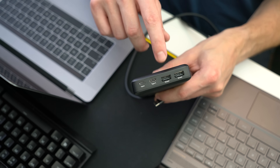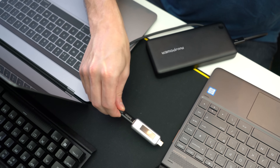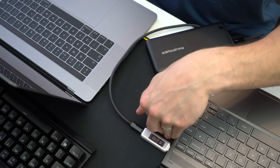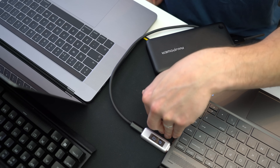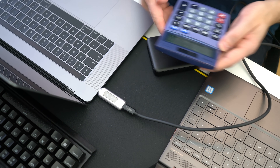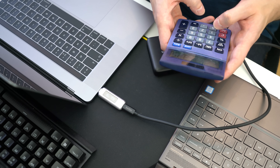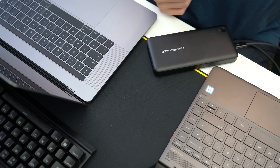Now we're going to use the dedicated USB Type-C port and charge directly with that. This is with the HP with the power off, and straight away we're getting much higher output — about 19 volts times 1.8 amps, which is 34 watts of output, considerably better than anything else we've tested so far. In the MacBook Pro with power off, we're only hitting 15 volts at around 2.1 amps, which is 31.5 watts going into the MacBook Pro.